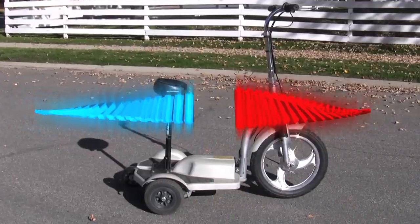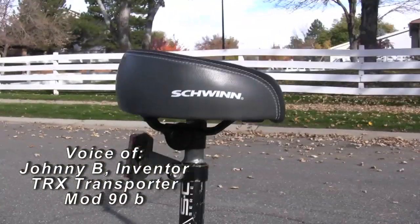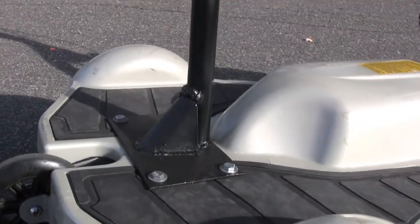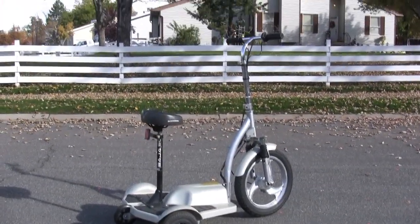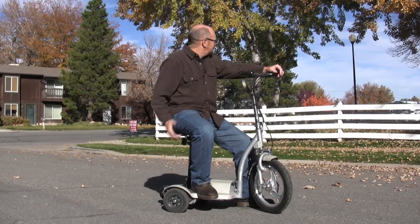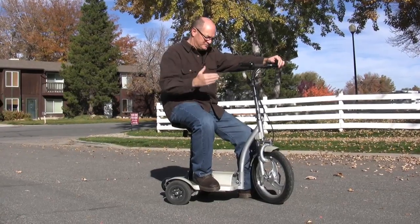You're watching the TRX 90B, the extreme scooter. This is not a standard configuration — I've done this myself. I got a standard bicycle seat; this is just a bike seat post. I bought an old bike, cut it out, welded together this mount, drilled holes through it and bolted it right on. If you had this done in a shop, it would probably cost somewhere between five hundred and five thousand dollars depending on the shop and the seat you choose. I've added this seat because you can take the scooter experience to the next level.